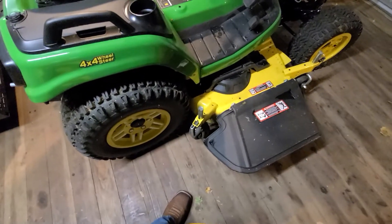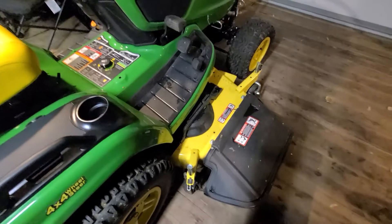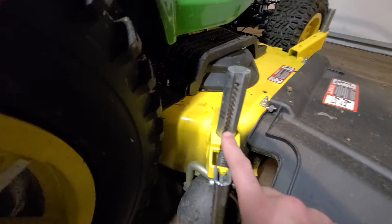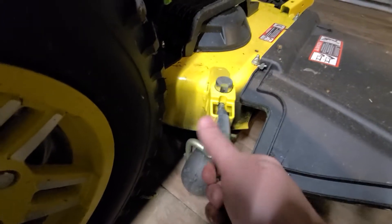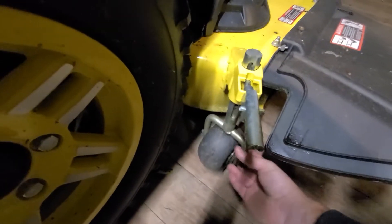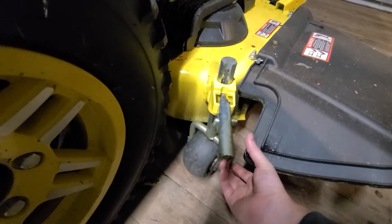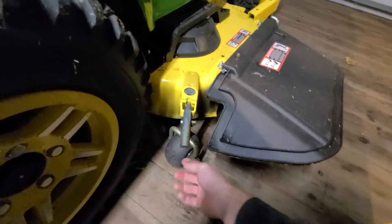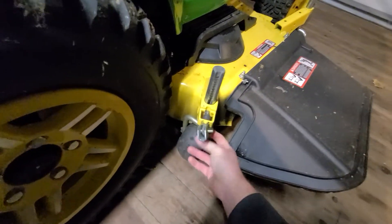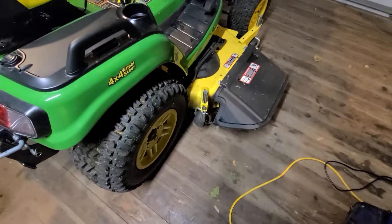The mower deck adjustment I've found to be somewhat finicky. These wheels have got adjustments — they're not spaced apart at all, it's literally every quarter inch is another adjustment. They are heavy — there are some serious wheels. I about drove myself mad for the first month running from side to side of the lawnmower trying to figure out whether I should have five holes or four holes, while getting the same amount of clearance underneath each wheel. It's kind of annoying, but if you've got a nice flat surface I assume it would run a lot easier.